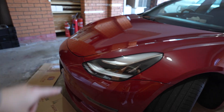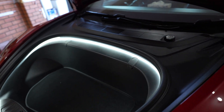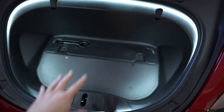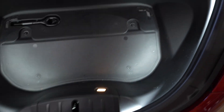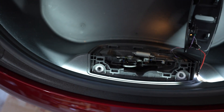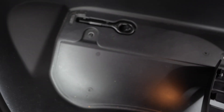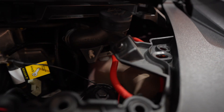Next we have to remove the front liner. Let's get the frunk open. To remove the frunk liner and the tub, it's actually quite easy. There are seven bolts total that hold it down and the rest are all clips. Take off this piece here and then you'll see two bolts — I've already removed them. There are also two bolts here that I've removed. I just have to remove this one, this one, and finally this one underneath this cover here.